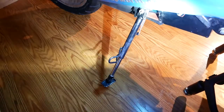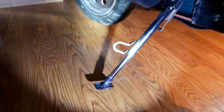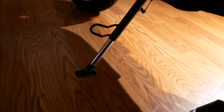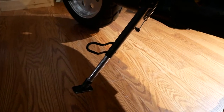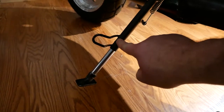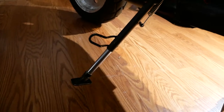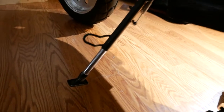Alright, last thing to show is my kickstand — the whole reason the damn scooter fell over on its side to begin with. My kickstand didn't work; it was too short after lifting the back wheel with bigger tires and so on. You can see I've added a section of chrome shaft in there — stretched it about three and a half inches. This shaft was the exact diameter needed to go inside this piece of steel pipe. I believe that was 15mm and the inside of the pipe was exactly 15mm, so I was able to drive it in there with a little interference fit. Put a pin through there to hold it in place, drove it up in here, got a pin right here to hold that in place. Perfect fit.